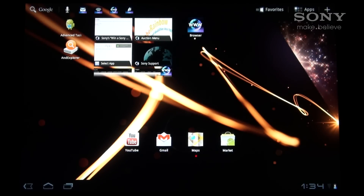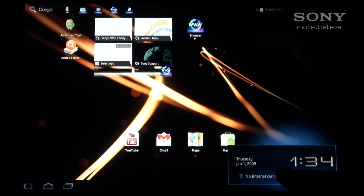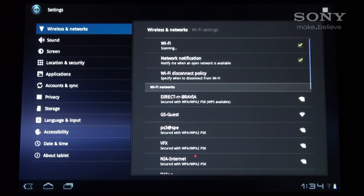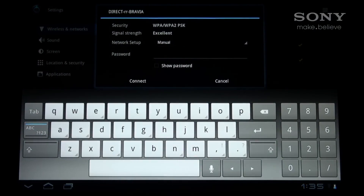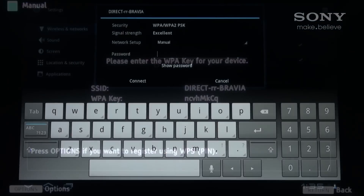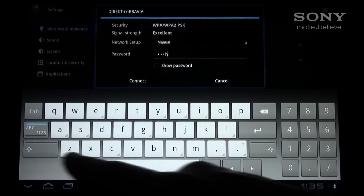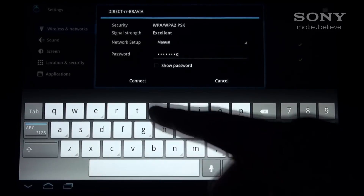Select the Settings menu, then Wireless and Networks, then Wi-Fi Settings sequentially on the tablet. The following screen should display all available networks in range. Select the network corresponding to the TV — the name will be the same as the displayed SSID name which appeared on the screen of the television. Next, input the WPA key that appears on the screen onto your tablet. Be careful, as the code is case sensitive.